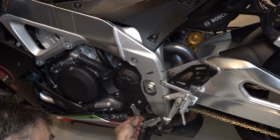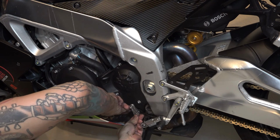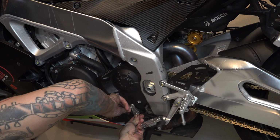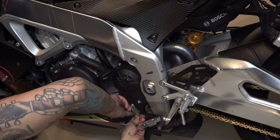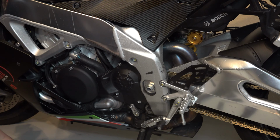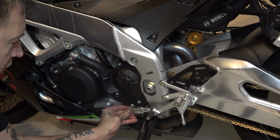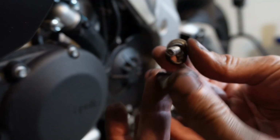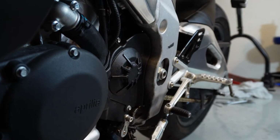All right, now we got this on, and the lines are perfectly lined up. Got our little side screw to put through there. And you want this outside edge flush, which should put that screw right in the groove. All right, the next we want to do is capture this one. Now remember, we had kind of this spacer and the 2 O-rings and everything to use on that fastener. The book does say it wants some Loctite. Put some Loctite in, let that dry.